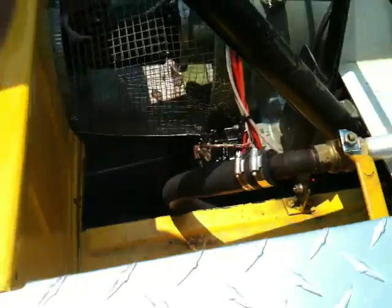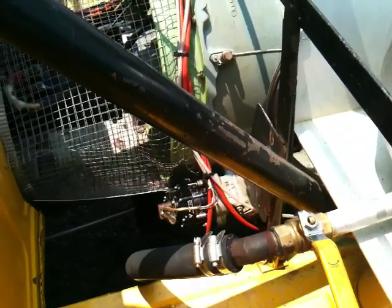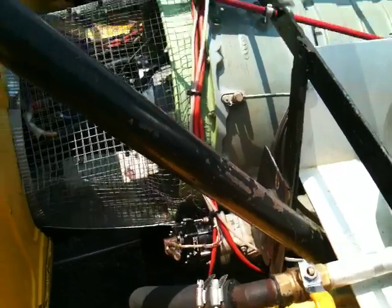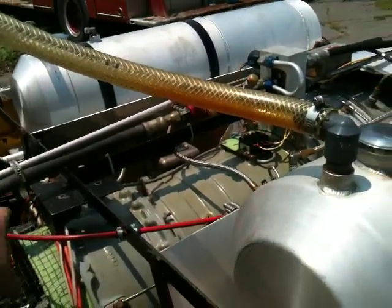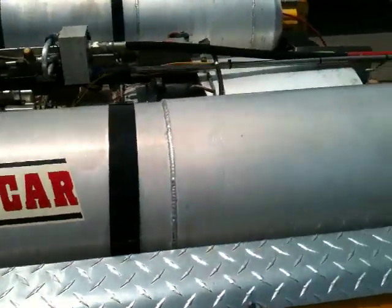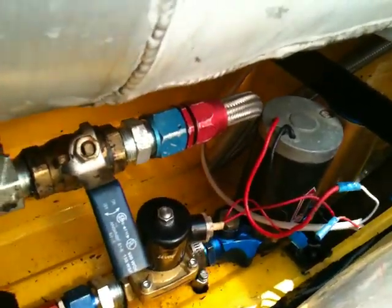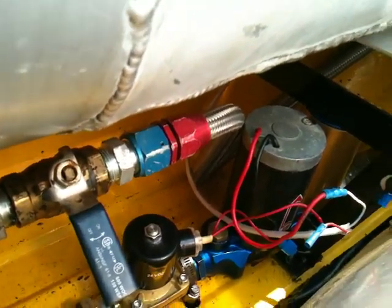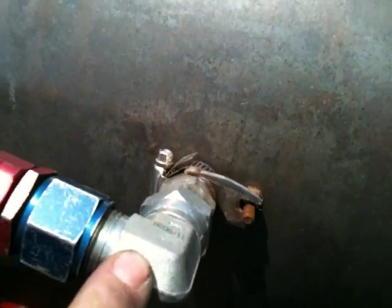All the fuel points have control valves. The way we're set up now, you make sure that you have five switches and five levers turned on. The driver side tank goes to the engine, and the passenger side tank goes to the afterburners. There is an additional booster pump on the back underneath everything — a 440 gallon per hour pump that goes directly back through the solenoid, through a number 12 line, into the spray bar and dumps massive amounts of fuel into the afterburner.